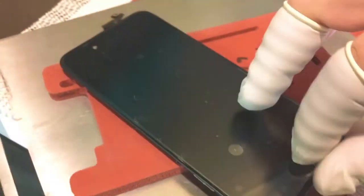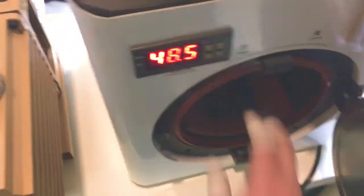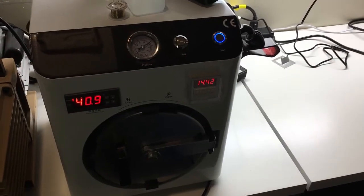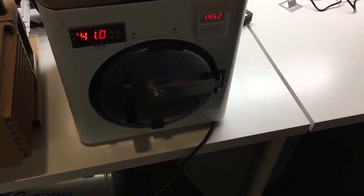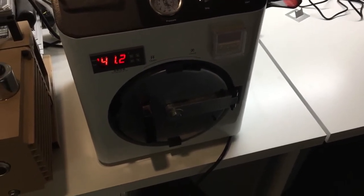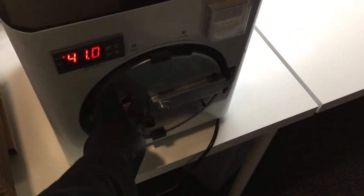Bubbles out using the autoclave that this will go into, and you can see the bubble there in the corner up top. There's one in the top corners, there's a tiny one. We will stick that in the autoclave here for 15 minutes at 48.5 degrees Celsius. Once it's done we'll remove it. We are now almost at the 15 minute mark. Once that is done we are simply going to test it again. We will make sure that there are no issues with the touch, with the 3D touch, with any of the pixels, and then we're going to also verify that the backlight looks great as well. So here it's just finishing opening it up and we will take a look and see what's happened.